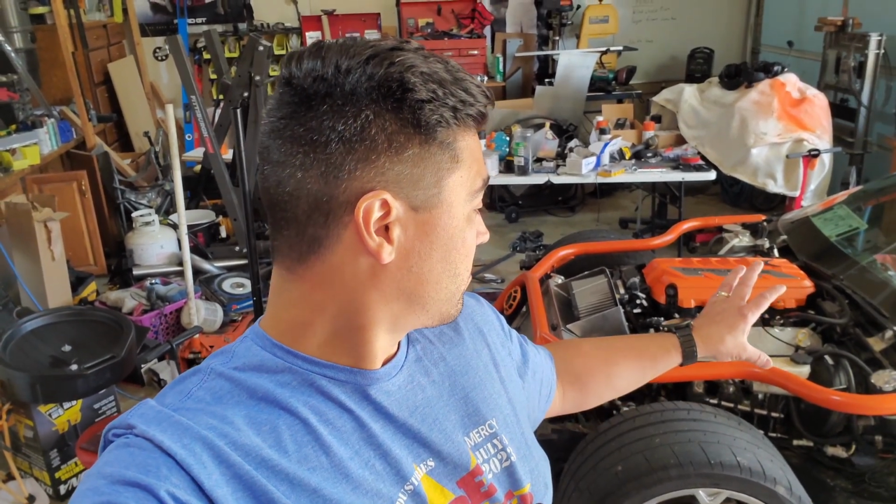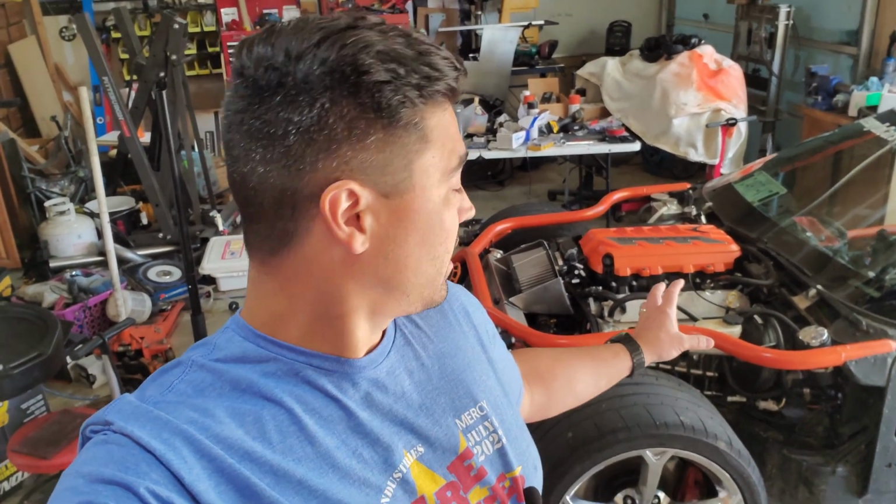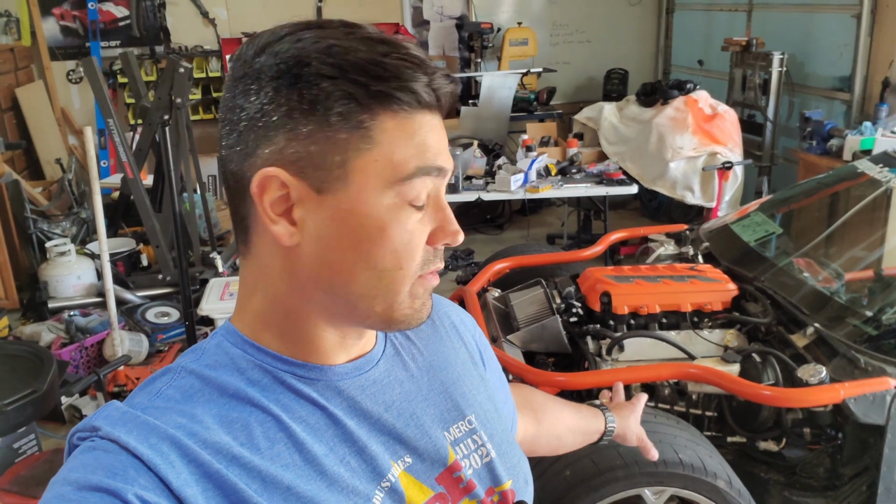It should be able to suck in a lot more air and not air from the bottom underneath the radiator. And I put a DRM bias spring in the brake master cylinder to put a little more bias into the back. And then I've opened my proportioning valve all the way up. And with the new brakes last night when I went to go bed them in, I'm definitely locking the fronts up first, which is good.